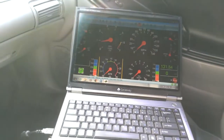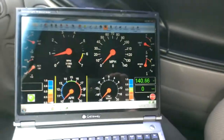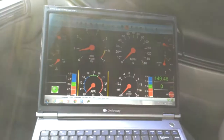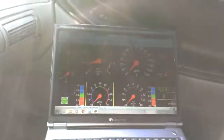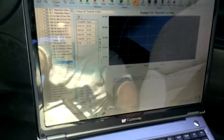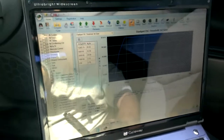So anyway, just an update of what's going on. I'm going to start doing some tuning stuff, get a couple things the way I like it. And then as I get money, I'll be buying some different injectors — 39s or 42s, somewhere in there. I've got to calculate exactly what I need, what my goal is, and then get an aftermarket mass airflow sensor. And then I can go through and do the tune on here. It's got everything — idle, that's where I'll be going with the dashpot stuff. I'll be going through and adjusting the mass airflow, the timing. I'll need to pull some of that back for the load when I do the turbocharging.